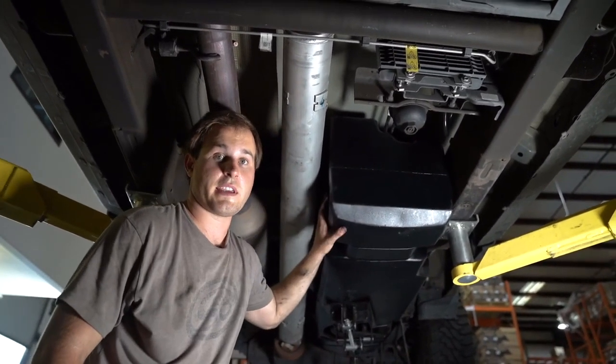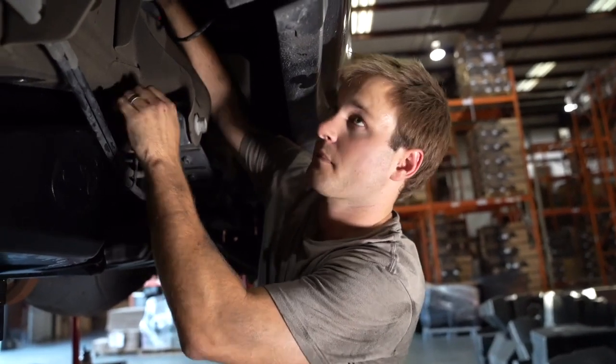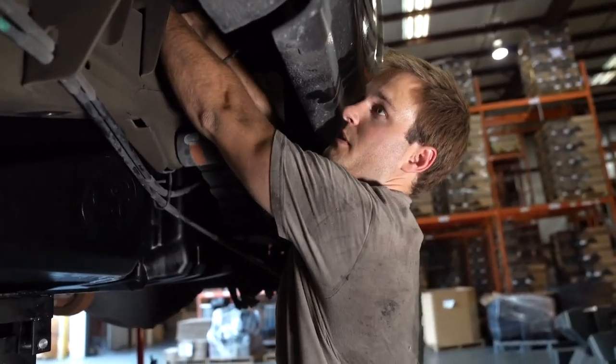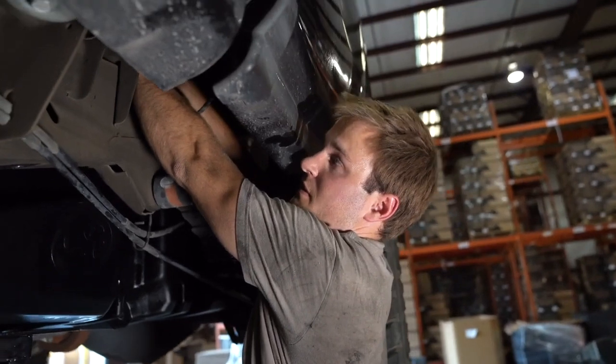Now we're gonna go to the rear part of the tank and reconnect the hose clamp onto the filler neck. Before putting the filler onto the S&B tank, place this white inlet check valve into the filler hose with the arrow going into the tank. You'll need to push it in a little bit. Now you're going to tighten up the hose clamp on that filler neck. So you want to hold the hose clamp in place, face the head towards the rear of the vehicle, which will be the easiest for you, and just get it nice and tight.